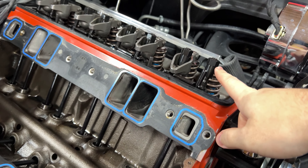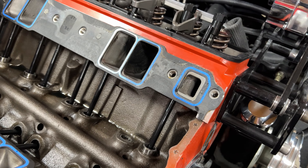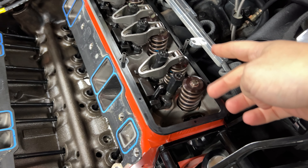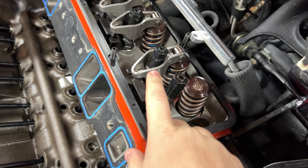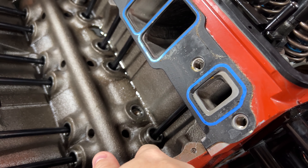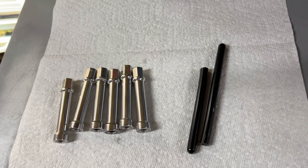It's a good thing we ended up deciding to change out the camshaft, because when taking the intake off, we discovered a pretty major issue. You'll notice right here — the rocker arm is not on and we're missing a push rod. We discovered when we took this off that something happened with cylinder one while the engine was running. Either we didn't have a rocker arm set right or something. We think maybe the exhaust side rocker arm wasn't set right and it caused some things to get loose. Because these lifters work in tandem with each other for this shaft, we think it caused something to happen and then it got stuck. Push rods ended up getting stuck, this push rod had completely come off the lifter and was just kind of hanging out. These two lifters had been completely pushed out of the shafts and the engine block, and that second push rod was snapped in half and just laying inside the engine block.